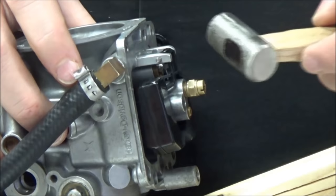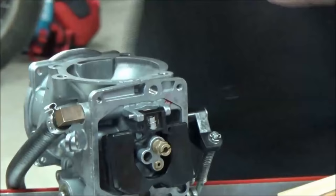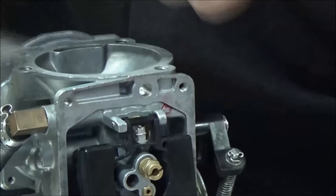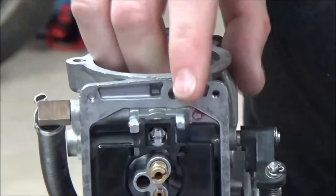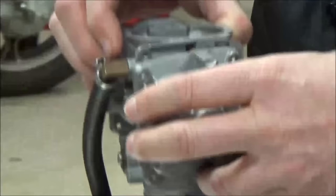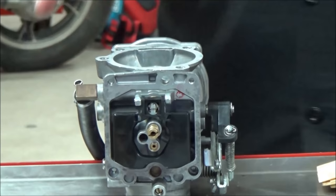Now I can go ahead and punch the pin all the way in. I'm using a little artisan hammer — being careful to support my thumb on the other side. I'm hitting down on the correct side, not the other, so I don't break the ear off. When the float bowl is on, you can see the cradle in there — the pin just has to sit in between those. Before moving forward I'm going to do a quick test fit to verify that the bowl will actually slide on. If your pin isn't in far enough it might drag and catch — that tells you there's a little more work to do. That is how you set float height.